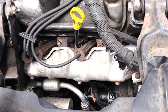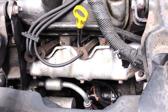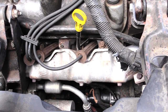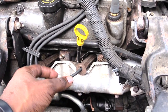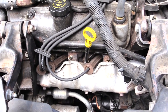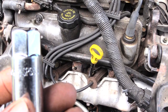What's going on folks, about to be showing you how you would change out your spark plugs on this Chevy Impala. This happens to be a 3400 engine and a 2000 model, but it's probably the same for multiple different years of Chevy Impalas. To get to your front spark plugs, just look right here in the front — you'll have one, two, three right there. The spark plug socket size you will need is the 5/8.